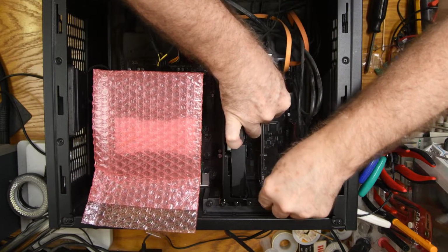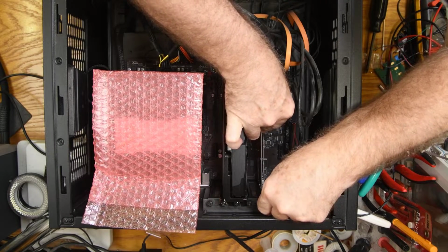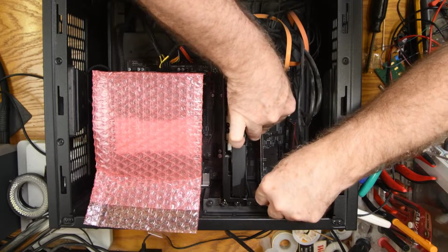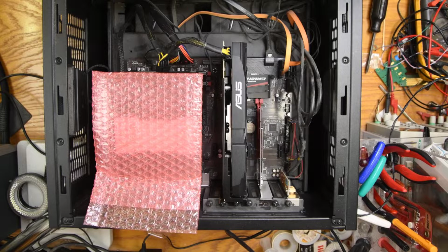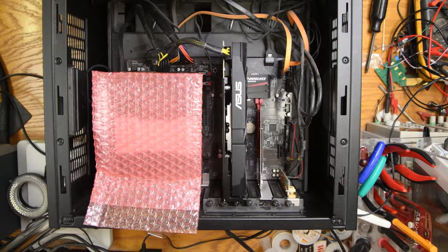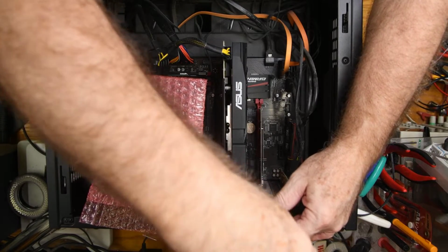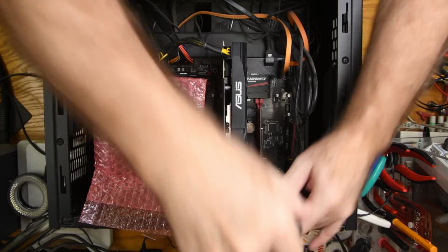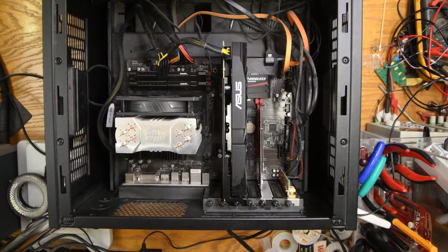That will give me a maximum transfer rate of around 2 GB a second. I'll have to see how close it gets to that. I'm pretty sure this slot goes through the chipset, so it might take a bit more of a hit. The other thing with this slot is that it shares the 4 PCIe 2.0 lanes with these 2 1X slots here. So I can't have anything plugged into them. I think if either is used, it would drop the full-length slot down to 2 lanes. Not even sure if the SSD would even work then. If it did still work, would really hurt the transfer rate.